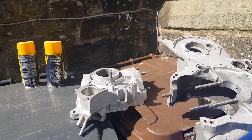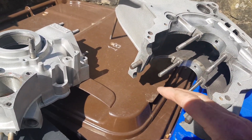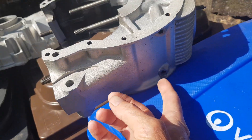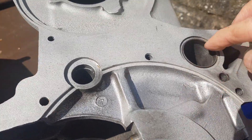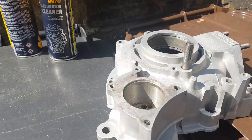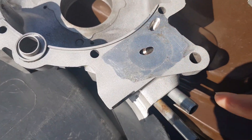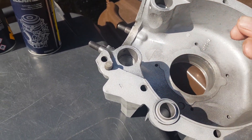I'm just finishing off cleaning the crankcases — I've washed them out several times, especially all the insides where that grit can collect. What I'm going to do now is use some carb cleaner to double-clean the actual oilways inside the cases. There are two main oilway drillings and they go all the way through up to the main bearings and along into where the oil filter goes. I'm also cleaning out all the oilways in and around where the oil pump goes, because there are so many little holes and pipes all around this area.